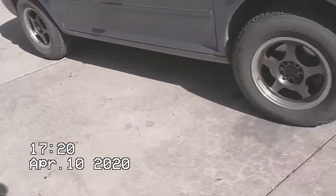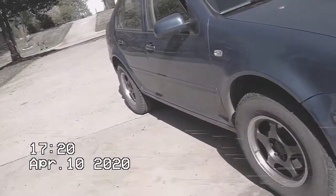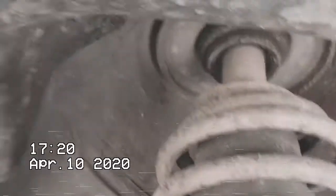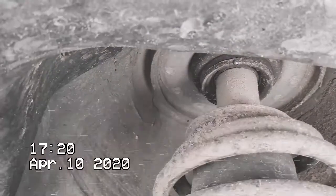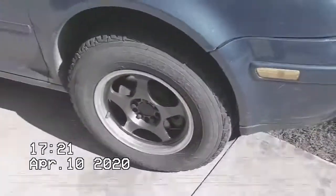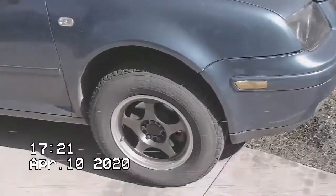I've heard of people using washers — I wouldn't, or at least make sure they're hardened black pipe. Basically pull the strut off, or pop it out the top, and the spacer goes right on top of the spring hat under the bearing. Two inches, boom, done. Don't gotta buy anything else. He charged me like 50 or 60 bucks, I forget.